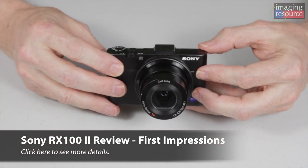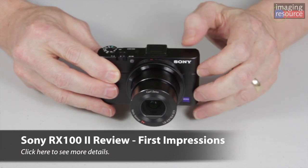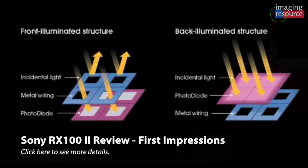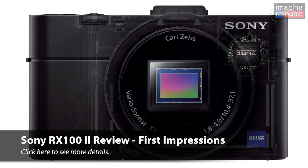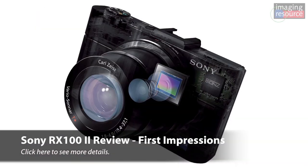I've saved the best part for last — the sensor. The Mark II has a new back-illuminated sensor, whereas the original RX100 had just a standard front-illuminated one. This is actually the first back-illuminated one-inch style sensor that's existed — Sony developed it. With any conventional sensor that's not back-illuminated, you have to lose some surface area for wiring, signals, and amplifying circuitry. That's an unavoidable loss of area that can't be used for collecting light. Especially as pixels get smaller, that wiring area stays the same size, and you start losing sensitive area on the photodiode.